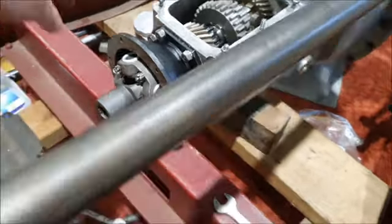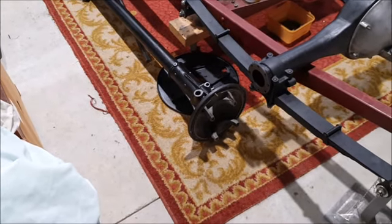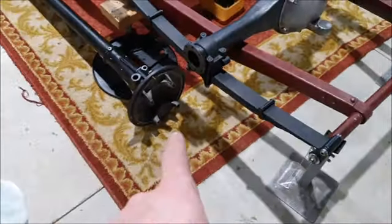That's all tidied up. So I may now look at reassembling the torque tube and checking in the manual or the book, the sort of one book we've got about these vintage Rileys. They talk about separating the rear axle casing from the end of the torque tube and the differential and everything going with this as a single unit. So I think the next thing I would have to do is assemble the torque tube and the differential. So I need to find the parts for those. I suspect I'm missing all the lock washers and things, so I'm going to have to order those before I can do much else. But another small step of progress, I guess.